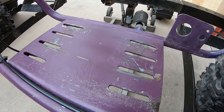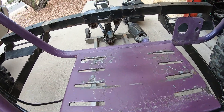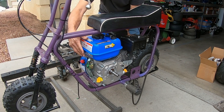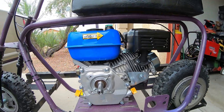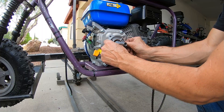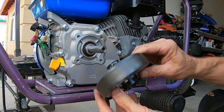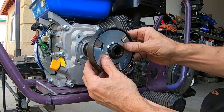What's nice about these Bonanza minibike mounts - you get all kinds of mounting holes, you got whatever you want on this thing. Looks like it fits on there really nice, a lot of room. That mounts really nice. Go ahead and line up the chain. I'll go ahead and just run a 12 tooth so it's a direct comparison to the Briggs - the Briggs had a 12 tooth.